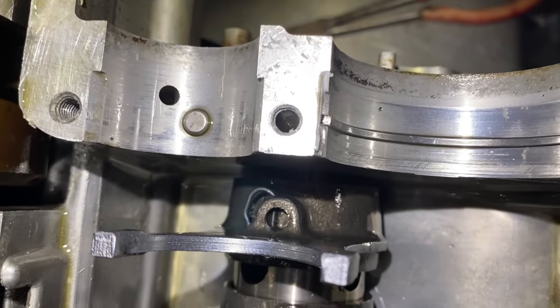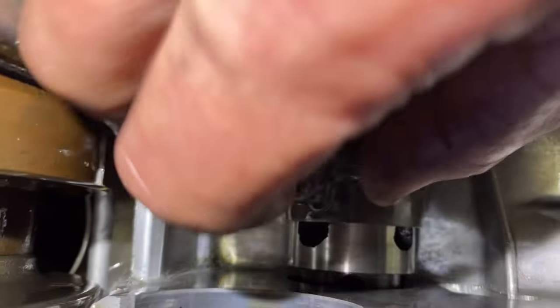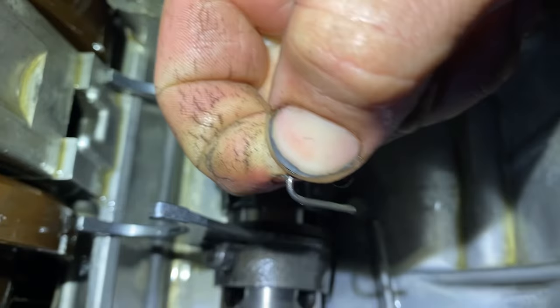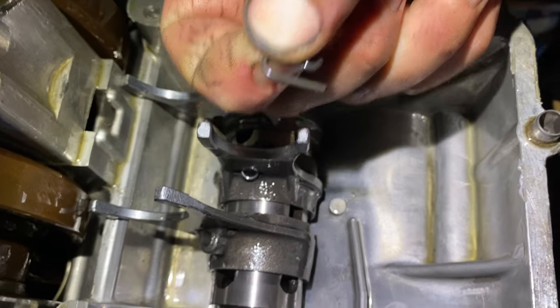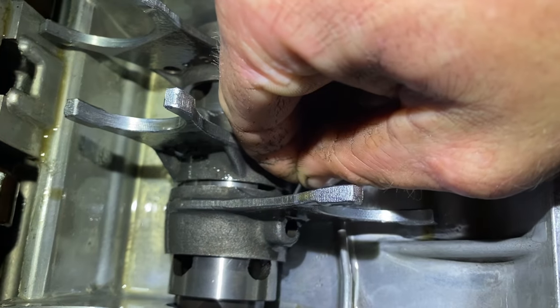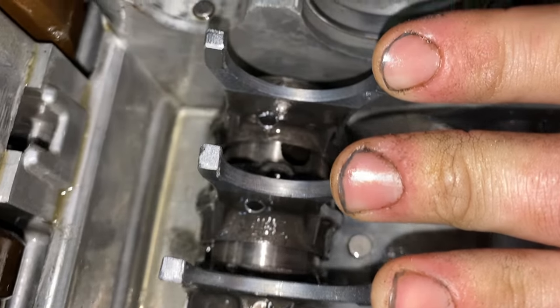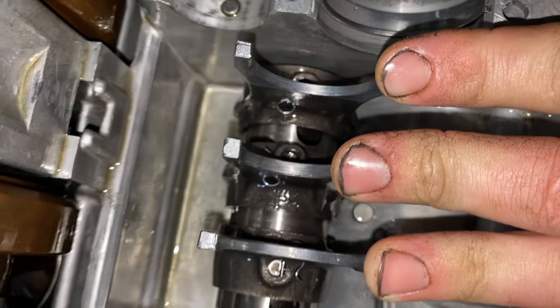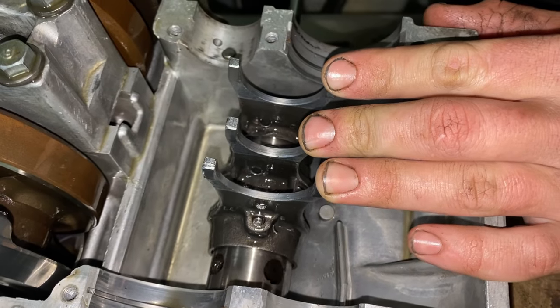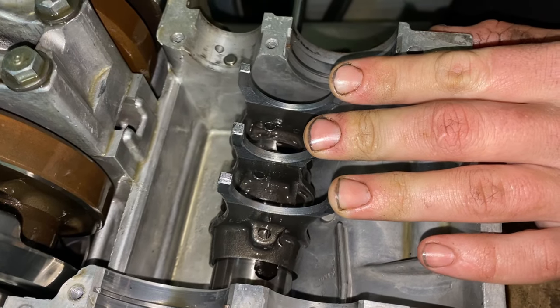So I'm thinking that they go that way, and someone was in here before and got this twisted around, because I can literally take these with my finger and pull them out, and I'm positive they're not supposed to be that easy to pull out. If I flip it and put them in this way, you can actually hear an audible click. Well, I've turned all these pins around. They slide through the other side, and now everything's clicked in tight and not going to fall back apart. You rotate the shift barrel, all of the forks move like they're supposed to, which means when I put the transmission back together, everything will work.